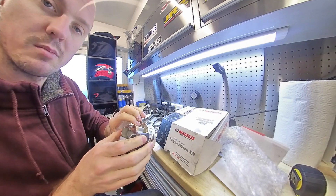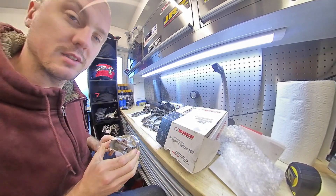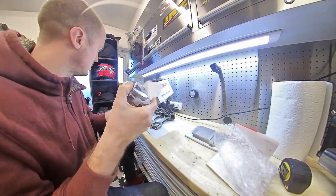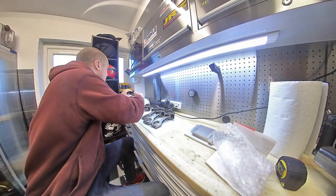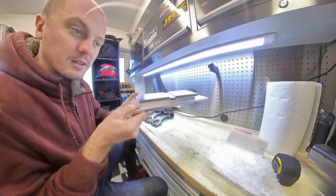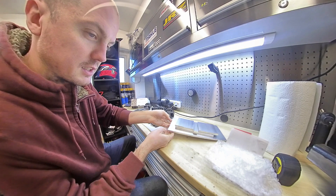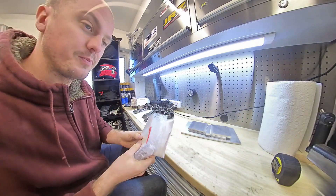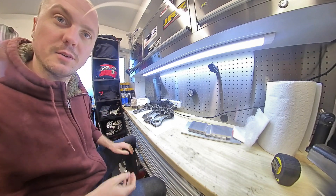The process at the moment is going to be to take the old pistons off the rods, and then I'm going to balance the rods, for which I have various bits of aluminium here that I'm going to form into a Conrod balancing device, and then reassemble the piston assemblies. And that's going to be the next few hours.